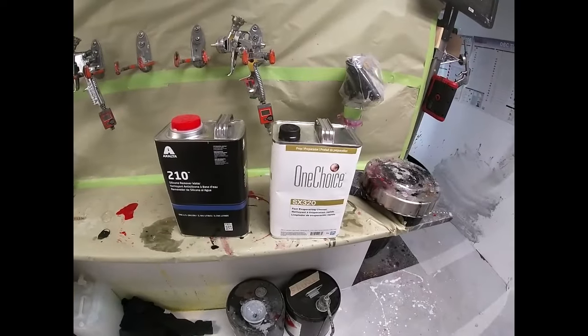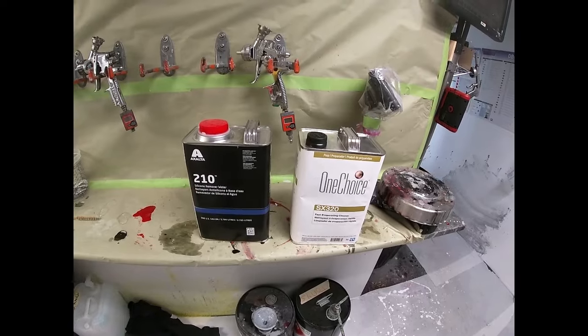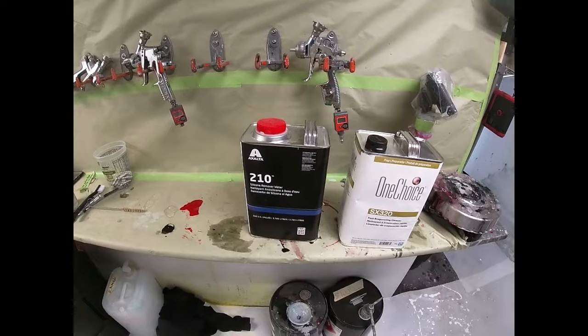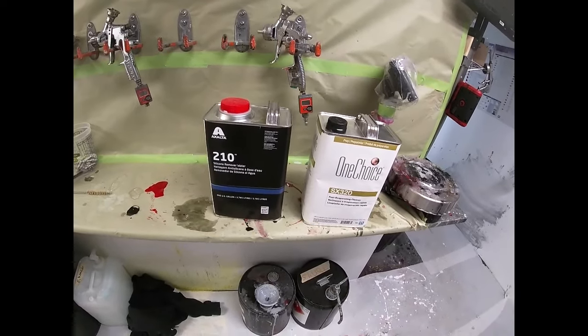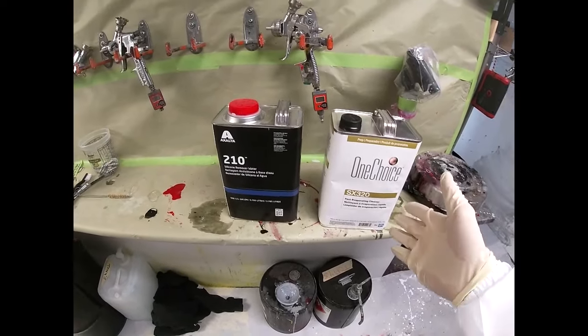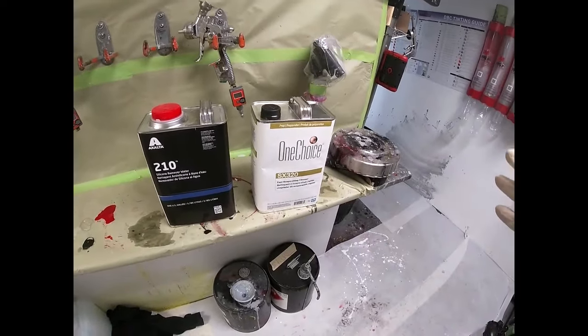On this Camaro, we're going to paint the outside today — BMW W93 Blizzard White Pearl. I'm going to wipe down first with a water cleaner. What that's going to do is get a lot of the dust, the micro particles out of the scratches — where a wax and grease remover type cleaner won't do that.